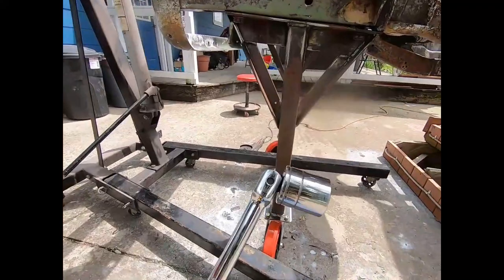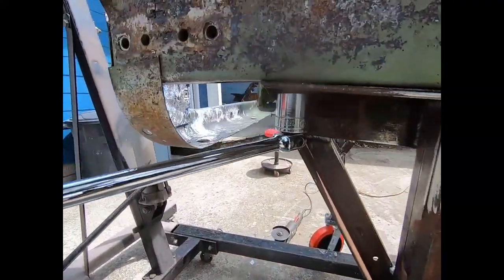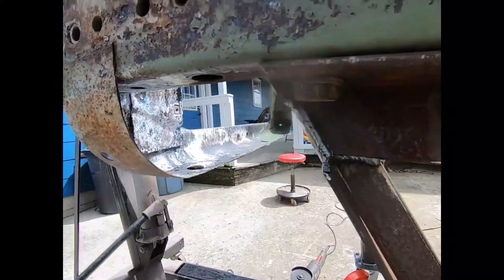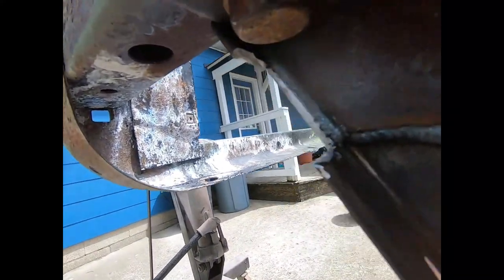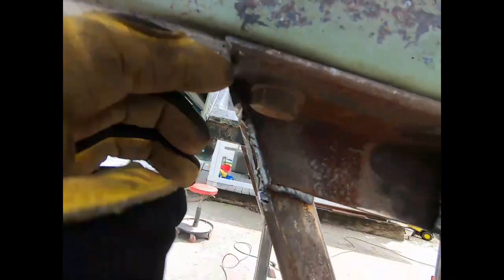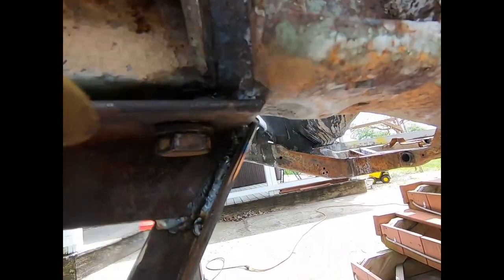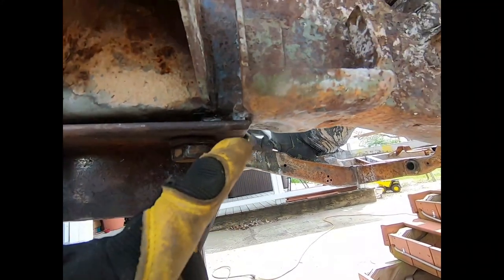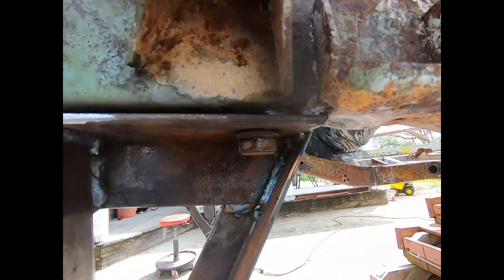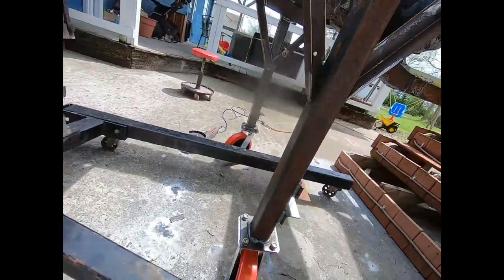In order for this thing to fit, basically your socket, because you really couldn't get an adjustable wrench on it, I went ahead and notched this out pretty good. We still have the stability back on the back side, and it curls back around here. We're flush there. I'm going to have to relieve this a little bit because, see, we have a gap. It's because of this bracket here. And so I'll probably make a cut where it'll bend a little bit, and then you can compress this back down. But otherwise, right now, it's actually very sturdy.